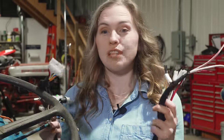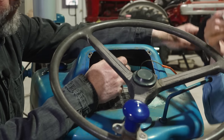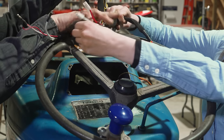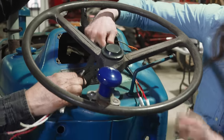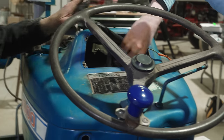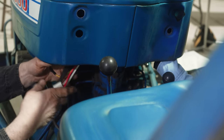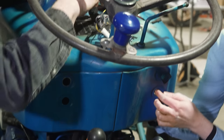Your wiring harness comes in two separate pieces just like the original harness, with a connector that goes up toward the front of the tractor. Look at the rest of your harness and you'll see a split — this split needs to go on that side of the steering column. The split with the five wires goes to the ignition switch and the other side goes to the headlight switch. As we fish it through there's a split around the steering column — put your hand down there so you can touch it and guide it through.